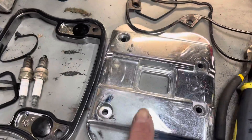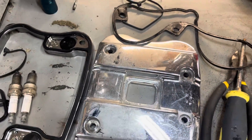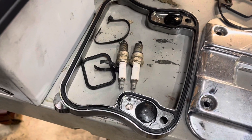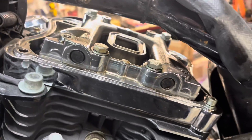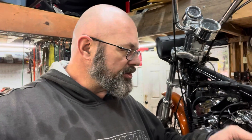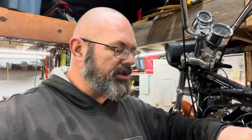Here's the top rocker box cover. There are just four bolt holes that hold that down to this middle spacer plate, and then that middle spacer plate will sit on the lower rocker box plate. In order to remove the lower rocker box plate, you pretty much have to remove the rocker shafts as well. As I loosen this up, I am going to do it in stages so it doesn't load it crooked, because I have actually seen these things break and crack if they're done improperly.